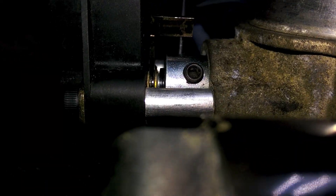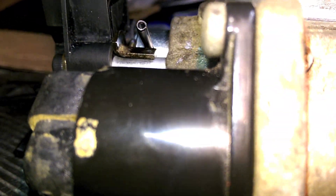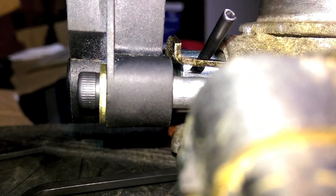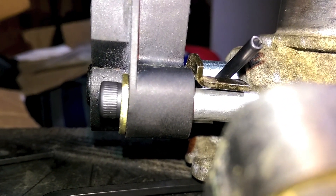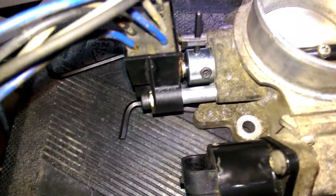It also opens all the way. It's important to use the thinnest spacer you can so that you actually get full throttle. When you open to wide open throttle there's a little gap in there so it doesn't touch — you get the full extent of your throttle body. Doesn't stick anymore, it snaps shut properly. Our TPS adapter is a go — only cost six bucks.